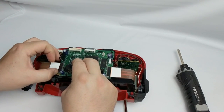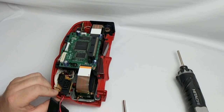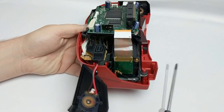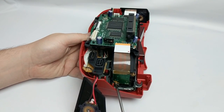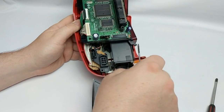Slide the lens back in and loosen that connector — or does it just pull out? Now we're going to unscrew those two screws on the board — one right there and one right there. We'll change our angle a little so we can see this more easily. Using my screwdriver here, we're going to back these out. On the bottom one, it looks like it's connected to an antenna or ground wire, so you want to be careful not to damage anything. Pop this screw out making sure we don't lose it, and we'll set the system itself aside for right now.